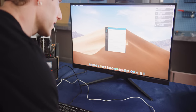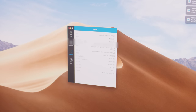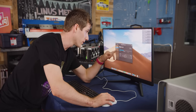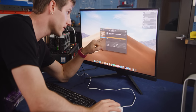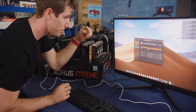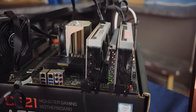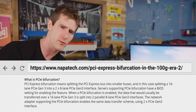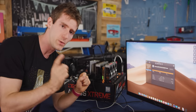It's a Mac Pro 6.1 running macOS 10.14.5, 384 gigs of RAM, and we've got 28 CPU cores. We do have one problem though — if we open up Disk Utility, we can see that only one of our 950 Pro SSDs on our quad M.2 PCIe card is being detected. For these 16x to 4x 4x slot adapters to work, you need PCI Express bifurcation, which not all motherboards support. It's more common in the server space, so we might need to reevaluate our storage, but we can still move forward for now.